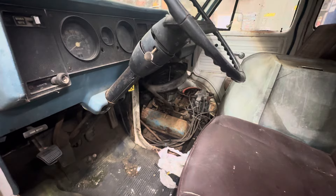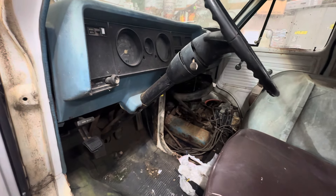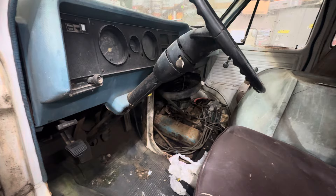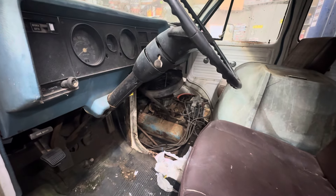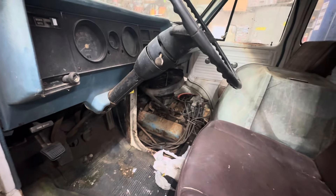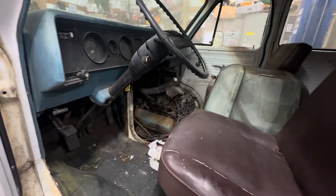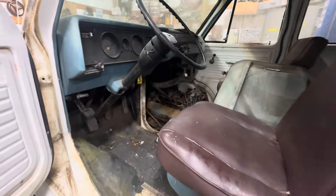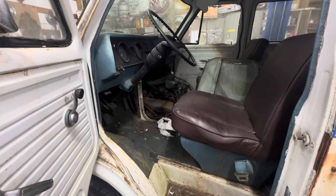It runs good. I did pull it off the trailer. The clutch is a little bit weak, and the valves are just a little chattery — but this thing has sat for so many years, and Tim only ran it just enough to pull it out of his shop. So plugs and wires I'll definitely do. I may pull the carburetor back off, but it idles well when you fill the bowl out of a priming bottle. I may go ahead and buy another AC Delco ignition module — the old one I had laying around is working, but I'd rather have a new one.